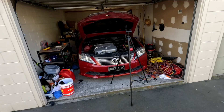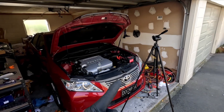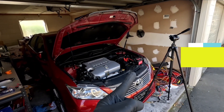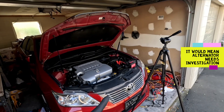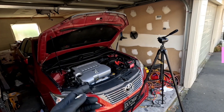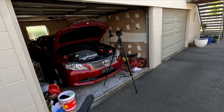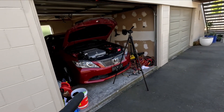If I were to unplug the jump starter and the vehicle immediately died, that means your alternator is bad because it can't charge the battery. You never want to keep your alternator charging a dead battery because you could kill the alternator. For those without a jump starter, you can use jump leads instead.